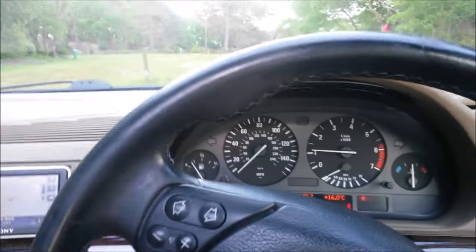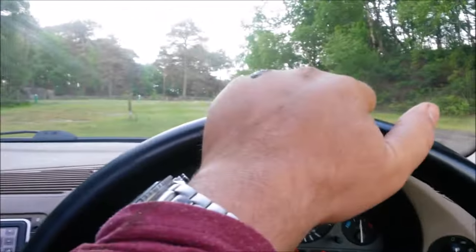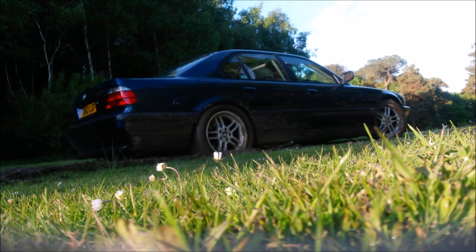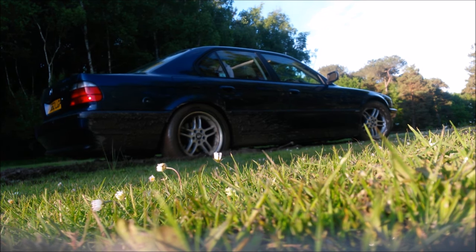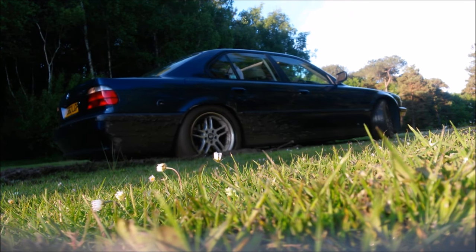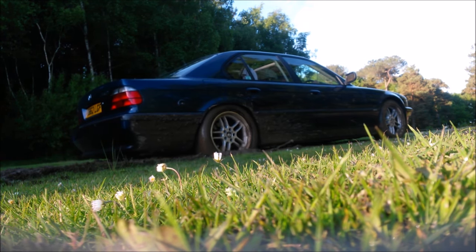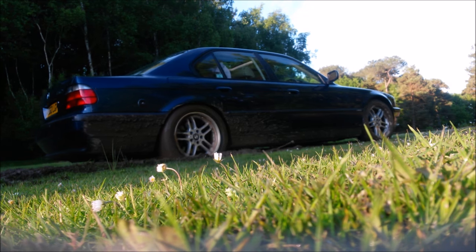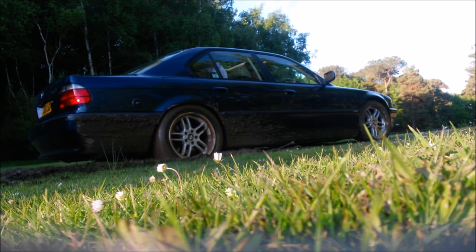The idea is not to dig the rut any deeper, but to actually carve out the front and back walls of the existing rut. I'm standing on the brakes each time I reach the top of both the front and the back ramps in order to change gear and then use those ramps as a run-up to get out the other side as quickly as possible, and then stand on the brakes again, repeat the process forwards and backwards and so on. Careful not to spin in the actual depth of the centre of the rut itself.